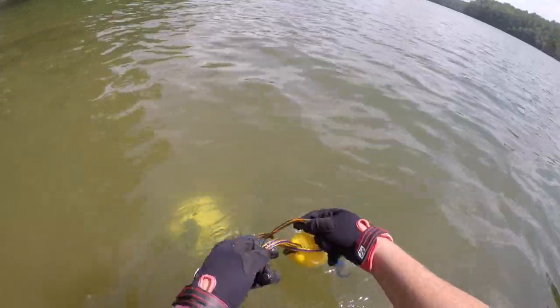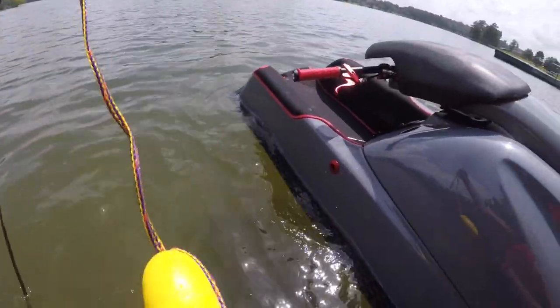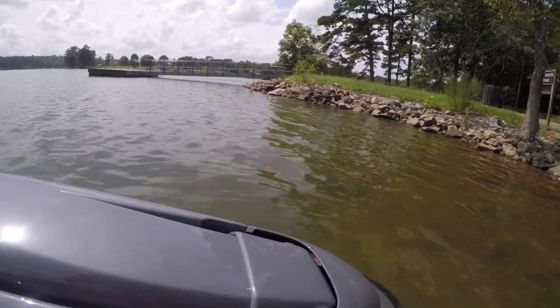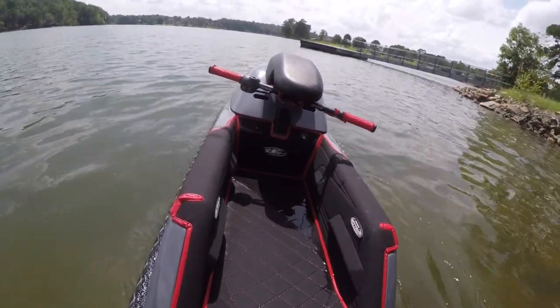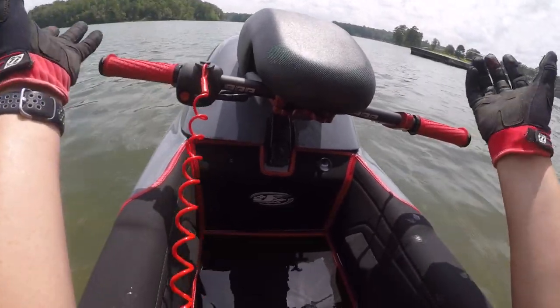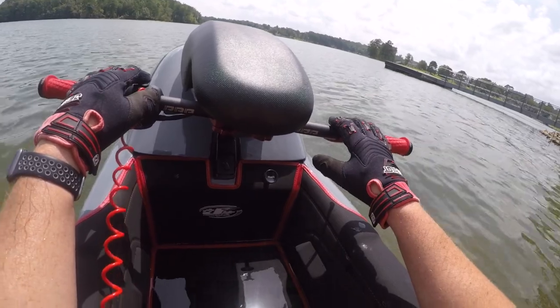But I have noticed that its throttle response is way better, a lot poppier, a lot more pop to it. It does have a light flywheel and reed stuffers put in there, so it's one or the other. I know the light flywheel made a huge difference, but I really do think the reed stuffers did make a difference as well.